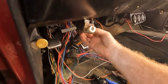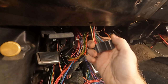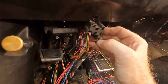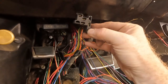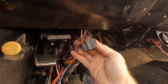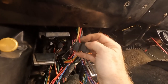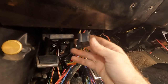There we go. That's how you take out your headlight switch — release the button, pull this out, then use something as wide as you possibly can to unscrew this. There's the headlight switch, and not much room to work with. I was able to unplug the switch itself, and this is actually the wiring I'm going to be replacing. I'm going to use this clip, get all the little prongs taken out. There are six wires — I thought there were supposed to be more. But this is everything: the headlights, taillights, parking lights, plus a power supply. I'm going to take a picture of this so I know which ones go where. This is the little button that you have to depress to get that rod free. It does not press very easily — there's a spring on it.